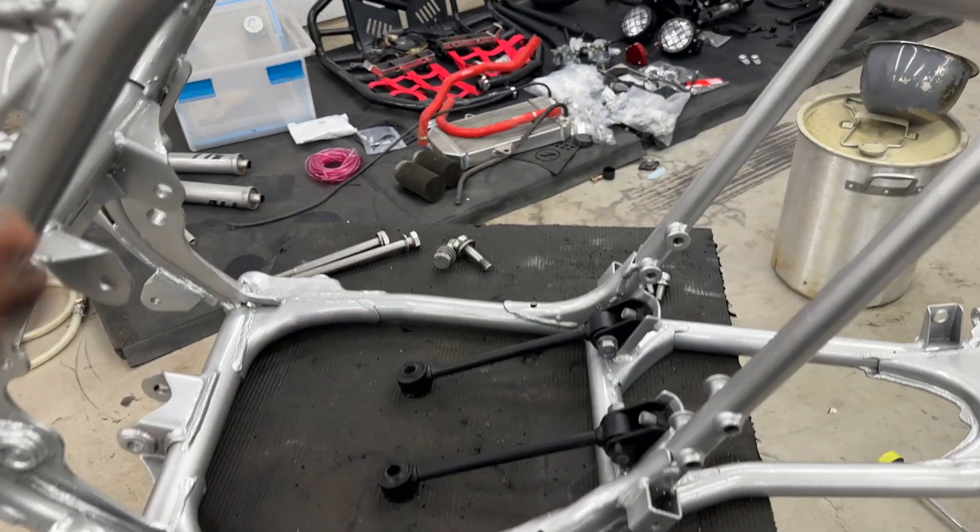Here is the Cerakoted T6 looking really good, just a little dirty and dusty. It looks great compared to how it would have looked if I hadn't tried to cover these things up. I am putting some grease inside on that seal just so it slides over the front of the motor easily - if you've ever done these kind of things you know they're a challenge. We're going to get this side on, get a couple bolts pre-anti-seized so they go into the motor fine and we don't have to worry about it once we get it all together.